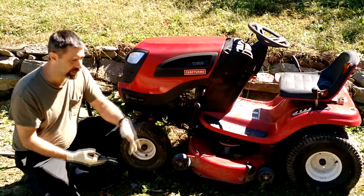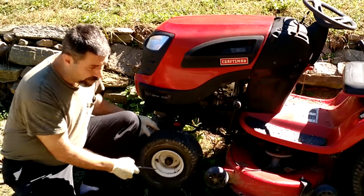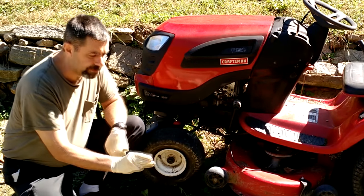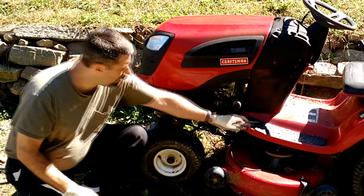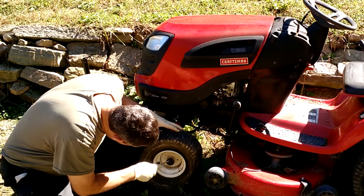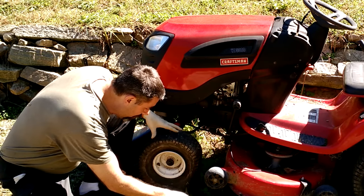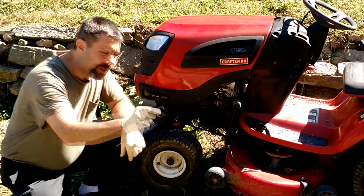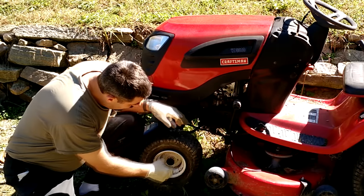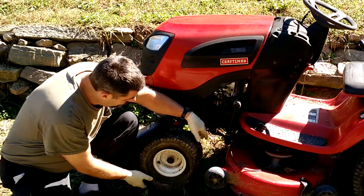In order to get them off the axle, you're going to need a pair of needle nose pliers and a screwdriver. There are rubber boots on here that you're going to be pulling off. I tend to grab onto them with a pair of needle nose, and they'll usually come off with a little bit of prying. Try not to break the boot itself, because it holds the grease. Once you have that off, there's a C-clip here, and you're going to want to just find the tab for it. Pull up, and there it goes. Try not to lose that. If you do lose the C-clip, you can always order another one — they come in two packs and are available online. Then there should be a washer, or sometimes two. This one has two. Just set those aside as well. That is all there is to it.